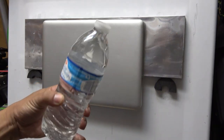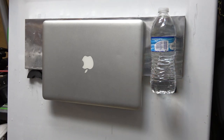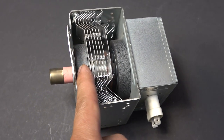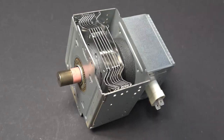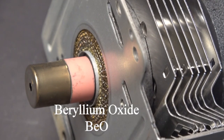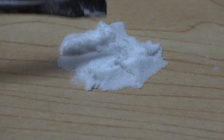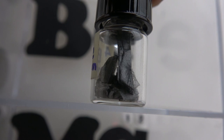Laptop computer, water bottle full of water — wow! The first thing we have to do is remove the magnetron out of the microwave oven. That's the easy part. The hard part is getting the magnets out of the magnetron. You have to deal with the pink ceramic part of the magnetron that contains the toxic chemical beryllium oxide. It causes berylliosis, which can cause permanent damage to your lungs if you inhale it in powder form.